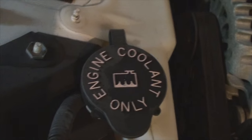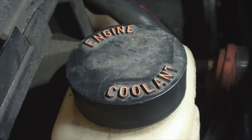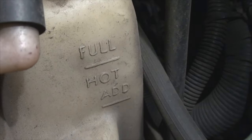In the old days, the coolant would just dump out onto the street. Modern designs will catch the fluid from the overflow tube and redirect it into an expansion tank, where it will be collected and then drawn back into the system as it cools off.